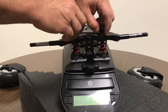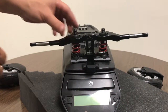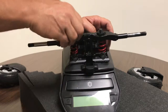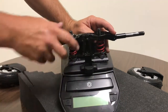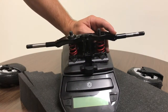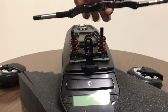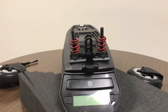These are lock nuts, as you can see here. Set those aside. They're the same ones that go on the wheels, but I like to keep everything separate. Now finally you're just going to lift the axle, being careful with these dampeners. Maybe you should take the dampeners off first and keep the washer. There's another spacer that sits directly on top of these rubber dampeners that are below the nuts, so keep those. As you can see, there's the washer sitting on top of the axle. So discard your old axle, and now we're going to talk about how to replace it in this next segment.